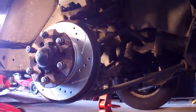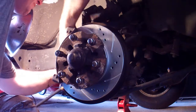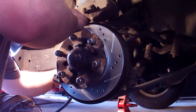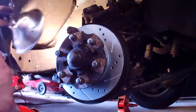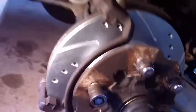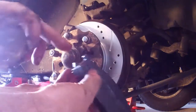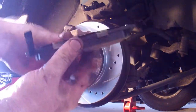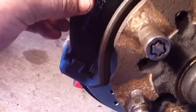Let's continue. These caliper bracket bolts are 15mm. With the caliper bracket back on, we can now drop our brake pads in. On the inboard pad it has your squeal tab — the squeal tab is right here — so I just stick this back on; it literally just sticks on. The pads slide right back in the way they came off. These are ceramic brakes — they're super hard; these are the easy ones to install. It goes in the slot and that's it. You're done.